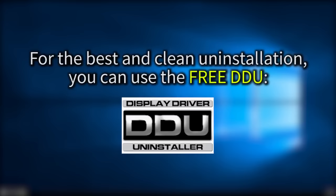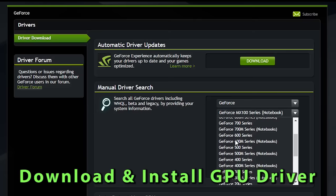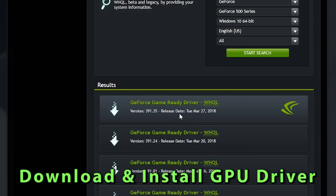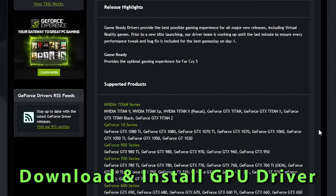Now we can finally install the card's latest driver. You can do this by going to the official website of the brand of the card and searching for the driver there. In my case, I went to NVIDIA's site. What's nice about NVIDIA is that they have a very user-friendly interface when it comes to looking for the right driver. So I was able to get version 391.35 for desktop, Windows 10, 64-bit, and International. If everything's going well, Windows should detect your external GPU and install the drivers.